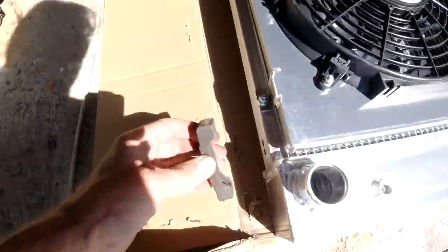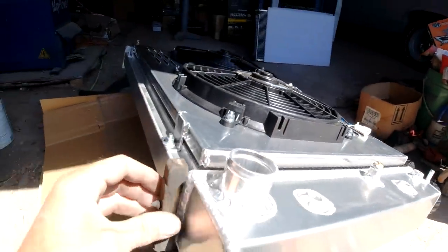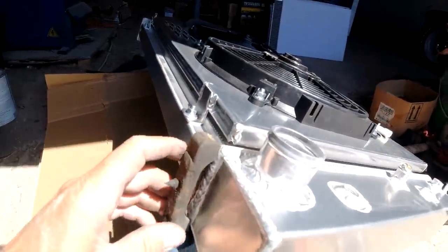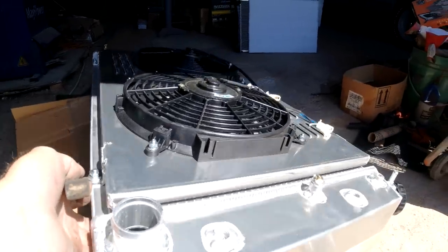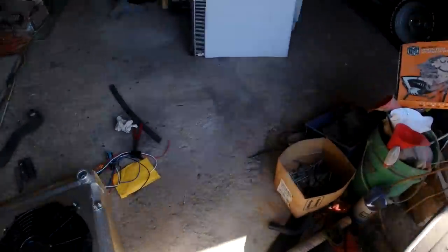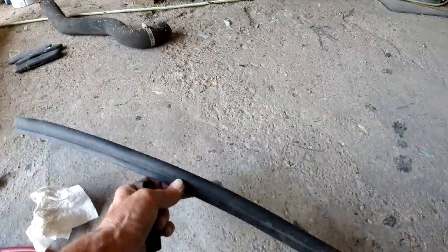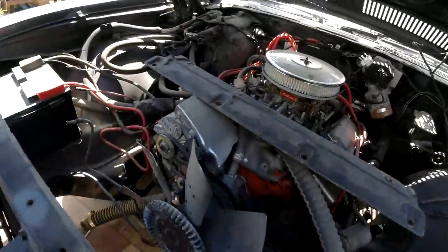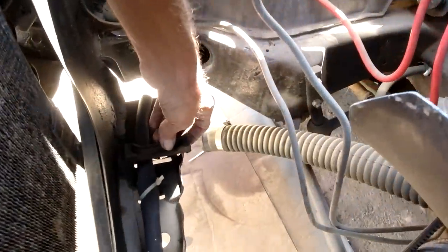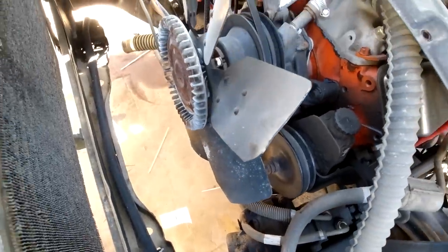Okay, the little rubber things on the bottom of the radiator. Yeah, I guess they do somewhat fit, but I went ahead and got this strip off an old Jeep hood to cowl seal and put that right along the bottom. See, that's where these go here, there and there. But I just put that strip down there, and we're going to lay the radiator on top.